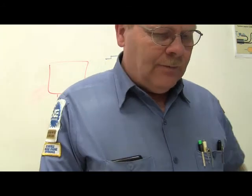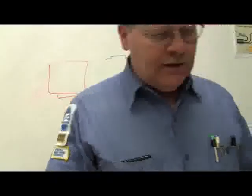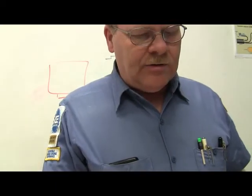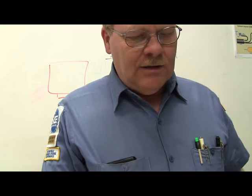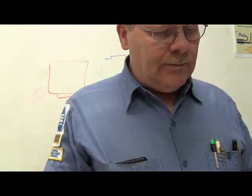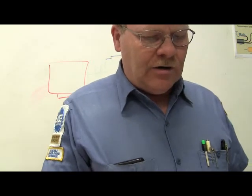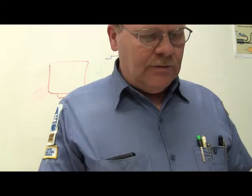I can see, y'all, that you guys have all got a perfect inside view of that. In addition to the strengthened joint between the front carrier and the annulus gear, how has the front carrier and annulus assembly been improved? Number eight. The splines on the front carrier are induction heat treated.